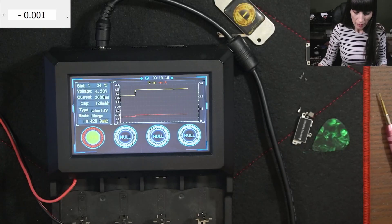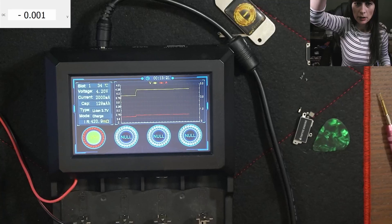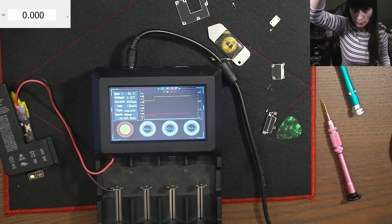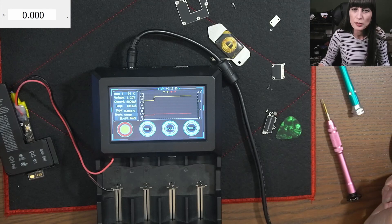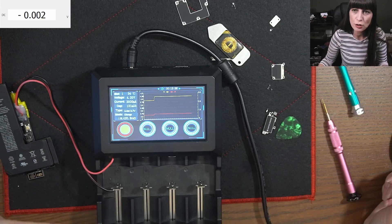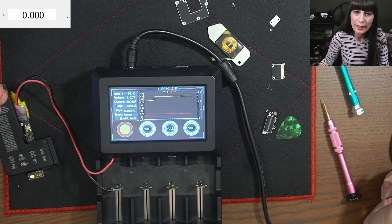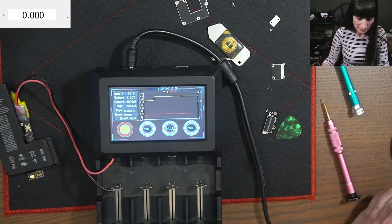As you can see, our device is now in charging mode because we ended the test. As you saw in the video, our battery capacity was around 2,300 milliamps after the device discharged the battery and counted the capacity. So at this point, the phone should show around 70% to 75% battery health, but not 100%. It's not right.